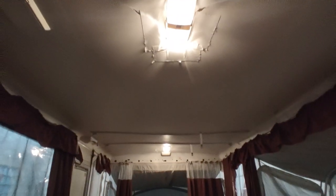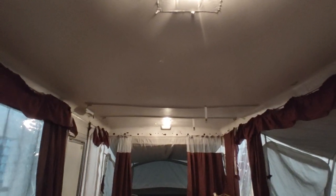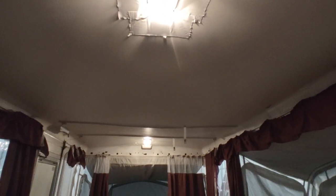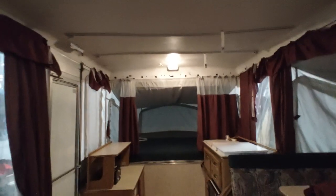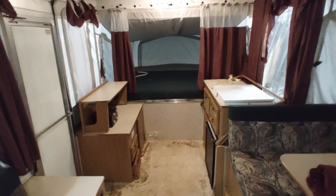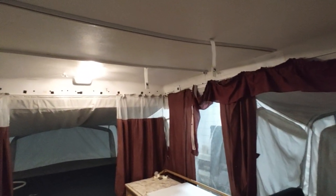The other big issue with this trailer is the roof — it is sagging. It's a one-piece composite roof and it's just bowed down the center from age. We are going to support it across with a ladder-frame type structure, jack it up, and fix it. We do have a solution for that. It's a fix you could attempt in your backyard, but it really takes some professional talent to properly execute a repair like that so it will last for many years.